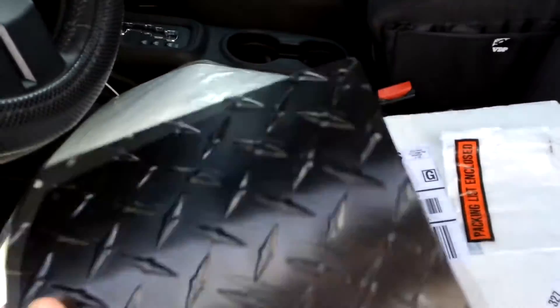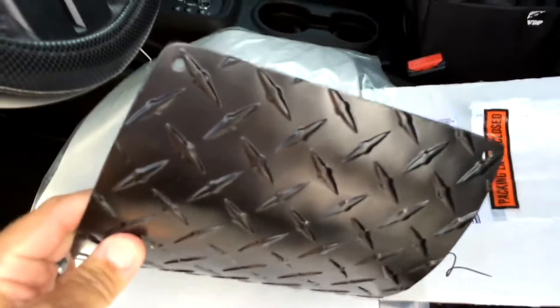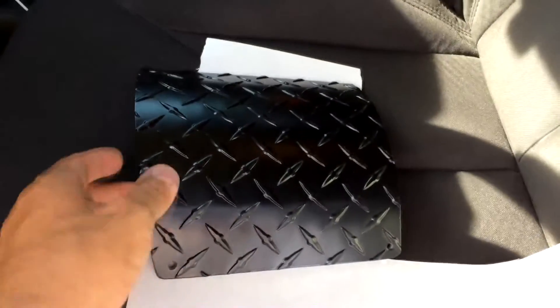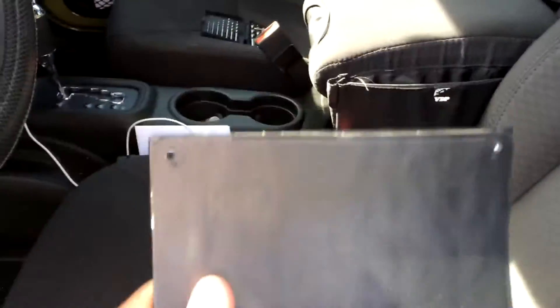Unfortunately, you're going to have to drill holes in your Jeep, which I'm not really too happy about, but I said I'm going to take my time and do this right. For the installation: this one is already done — you can see the rubber is underneath. I already had it cut out and stuck to the cowl cover. Basically, you flip it over, fit it on there, trace it out, and then take an exacto knife to cut it out and stick it on. Then I took a drill and made the holes, as you can see right there.